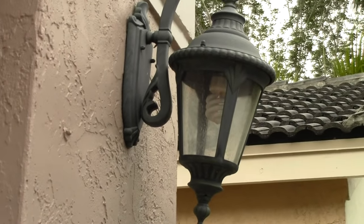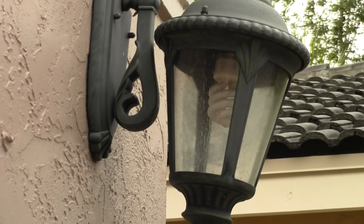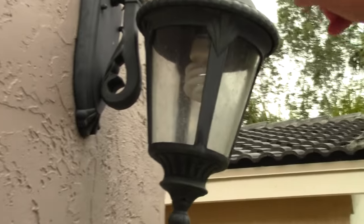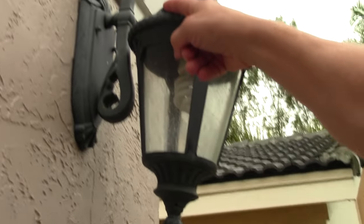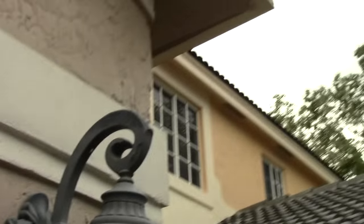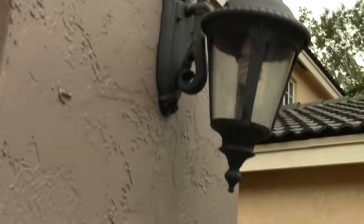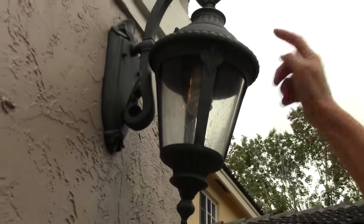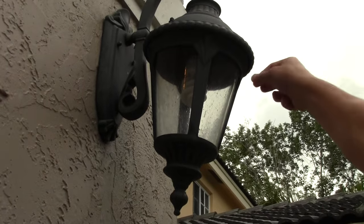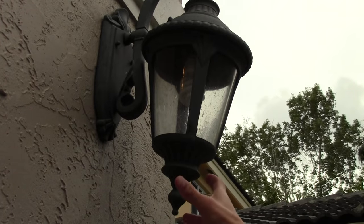Come a little closer with the camera. If you notice, there's a couple of nuts — there's one here, and you'll find one on the other side. Now depending on the actual lantern, you might have more than that — you might have four of them, or two and then one here and one here. But either way, you're going to have to loosen these nuts to take this bottom part down.